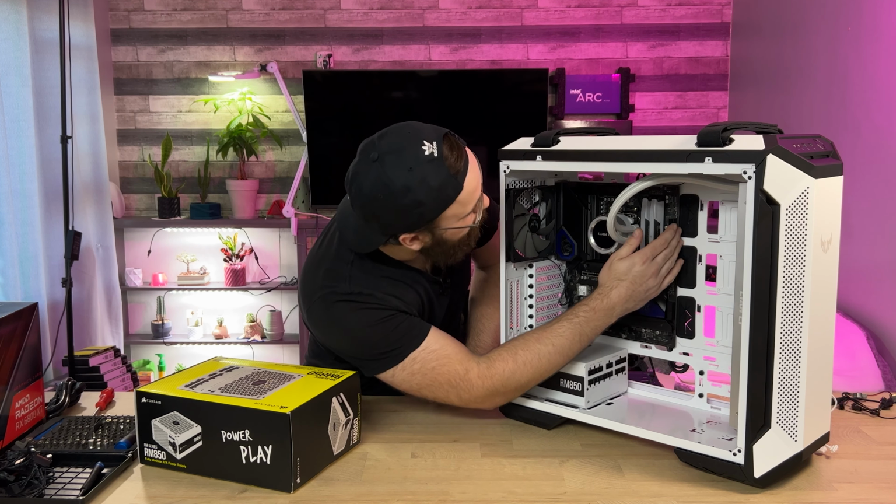So there we go, the basement's back in. The power supply shroud here cleans things up quite nicely. There's quite a bit of room still in here for extra activities. You could mount another set of fans behind this radiator if you wanted. Lots of mounting here for 2.5-inch hard drives. Mount a pump reservoir in here for custom water cooling. But yeah, let's get the GPU in here.